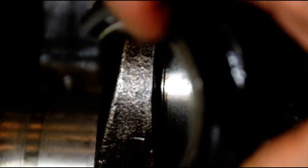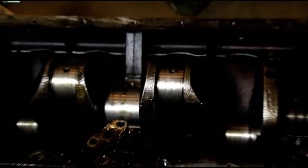The caps, they're not too bad, but the crank — the radius on every single one of these has been chewed away by the cap. Sadly, this crank is junk. You wouldn't weld all those up and re-grind it. The crank is junk.